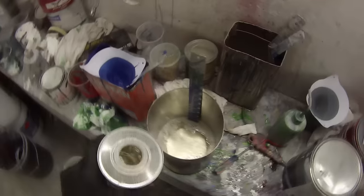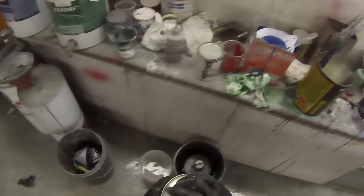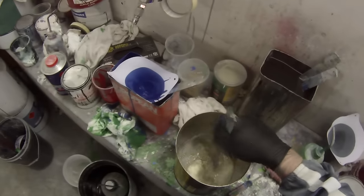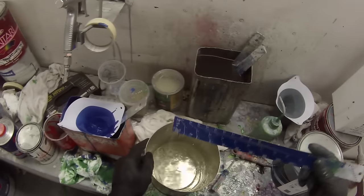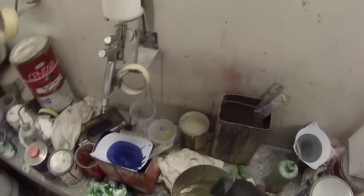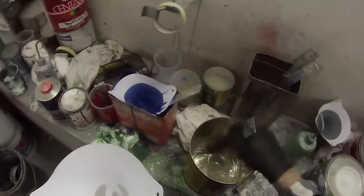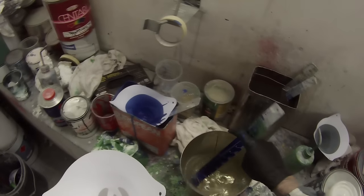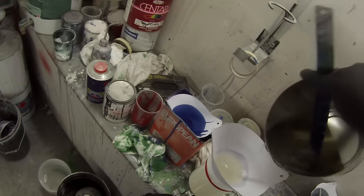Heating the clear is basically going to help it dry without getting runs. By the time I'd finished putting the first coat of clear on, the second coat was right to go straight over because it tacked off quickly — probably about 50 degrees Celsius, though I can't be 100% accurate. In the future I'll give exact temperatures since I've ordered a digital thermometer. I've also used fast hardener to speed up the drying process.